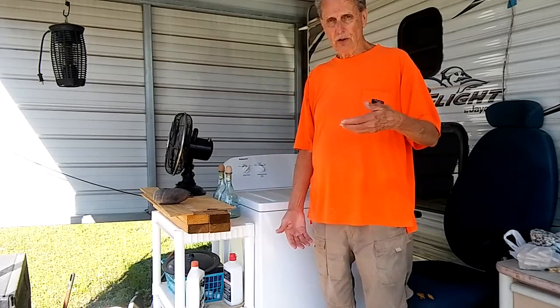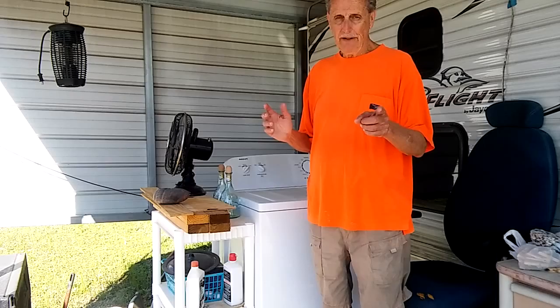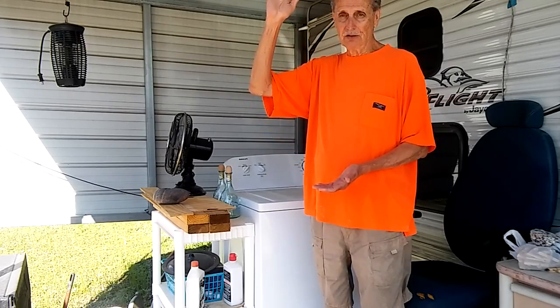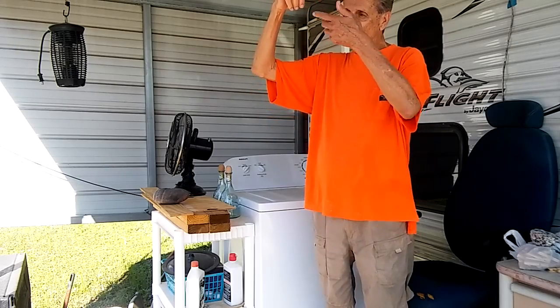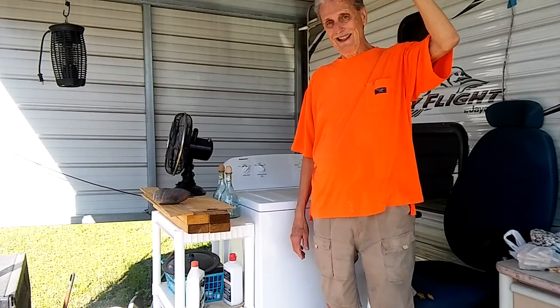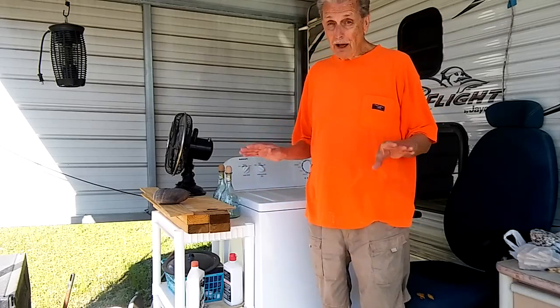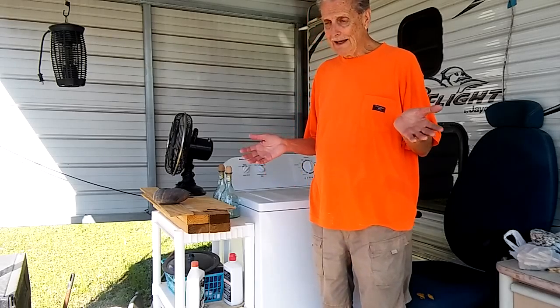If you put it down, it's just gravity flow, so it just flows right out. Bear that in mind: if you hook up a washing machine, you've got to elevate that drain hose. You'll see where there's a hookup for it, and you can run it down to your exit hose, but it's got to go up first and then down. If you just run it straight out, it will not work. I tried it three times and it didn't work.